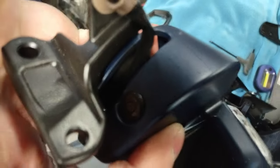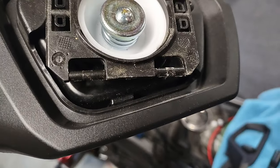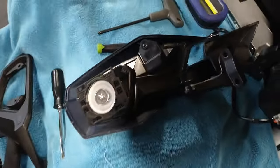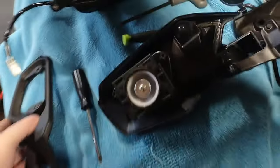When you remove these two screws and the push pin, it doesn't feel like it wants to move. What you do is see that little lip — just stick a tiny screwdriver right there to pop it and the whole piece pops off. As you move it away, get it over this piece and there'll be one little connection down in here that you pop out with a little screwdriver. Then it looks like this after you get the cover off.